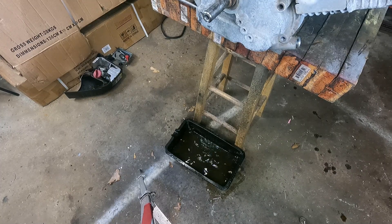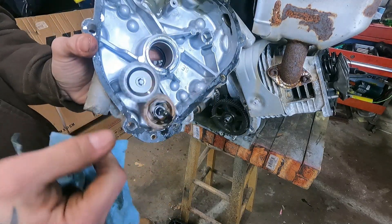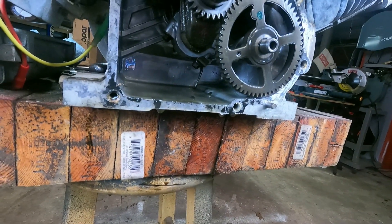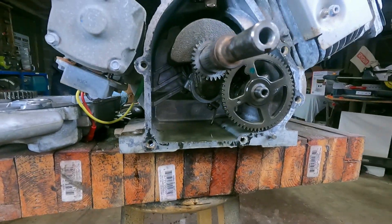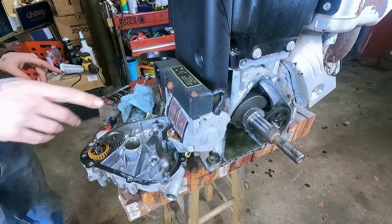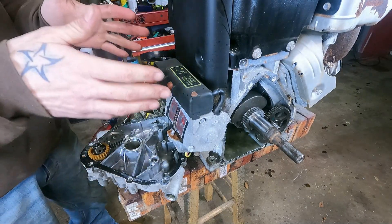Not even a lie, that is doing a fantastic job. All in all, broad strokes, really couldn't ask for better than that. She's coming, just being stubborn. Governor didn't fly apart. Usually you're going to see a ton of part numbers right down there. Everything looks good. The valves looked good. Camshaft's clearly not seized. I guess the piston might be seized. Should we pull the head off? I forgot to check the first thing you're supposed to check. These starters can get stuck engaged and seized and all bound up. I've seen it — I've actually shown it on this channel before. I have a number of reels showing a starter seizing up a snowblower.